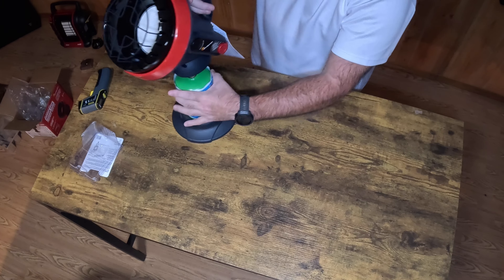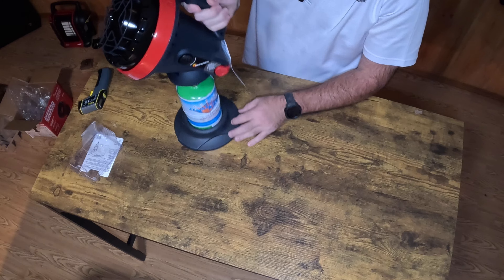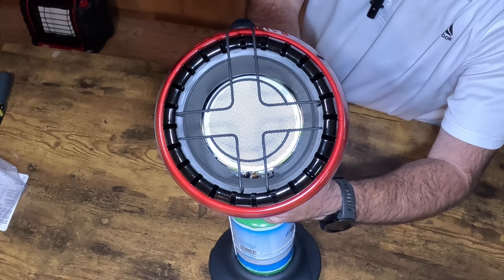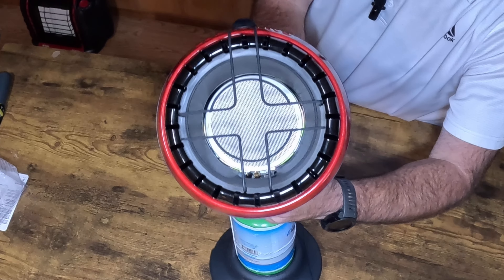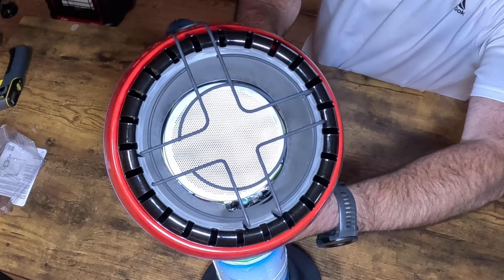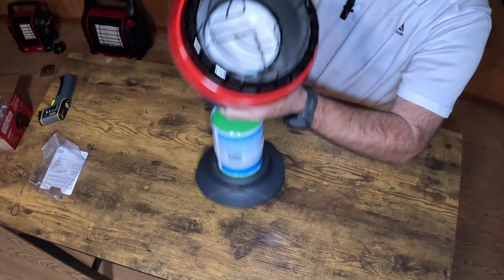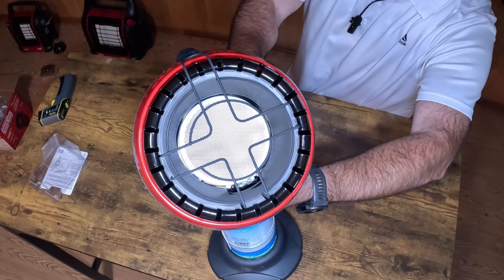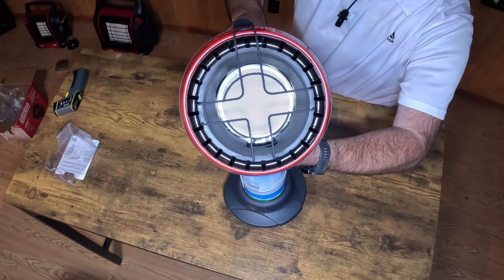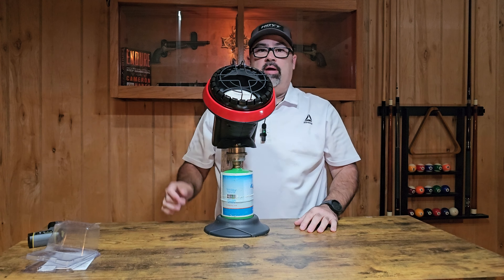Ignition is just super simple. We just have 'on' over here — it's red — and 'off' at top, and it does have some clear instructions right there on the side. Down at the bottom of that white tile is a small ignition source. As you press it, it's going to spark, and once it sparks you're going to have a blue flame come out. That blue flame is your pilot. You're going to hold the start for about 30 seconds — what that's going to do is heat up a safety heating element. And once you let off, that's going to heat up the rest of that tile, and you can see that flame run across the tile. Now we're activated and we have full heat coming out of it.